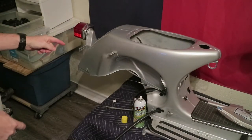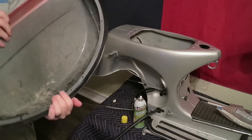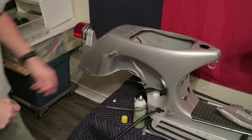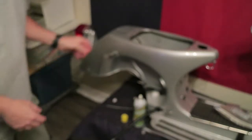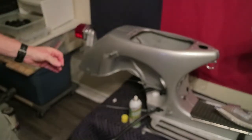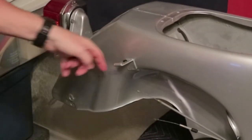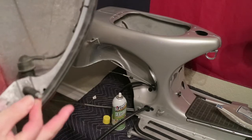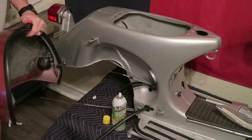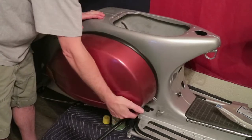Let me show you how to put one of these cowls on. This little clip - I don't know what they call it - is where the cowl hangs on. If you look at the underside of the cowl, it's got this little spring piece right here that hangs onto that piece right there. On the top of that little piece there's a little rubber bumper that goes on, so we're going to put that on using a little silicone and a little screwdriver. Got the little bumper on. Then you slip this into the back like so, and it takes some force to kind of get this down on there.